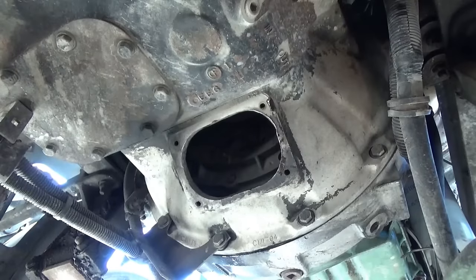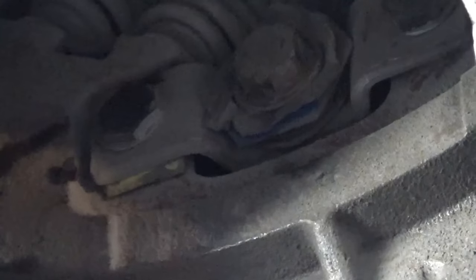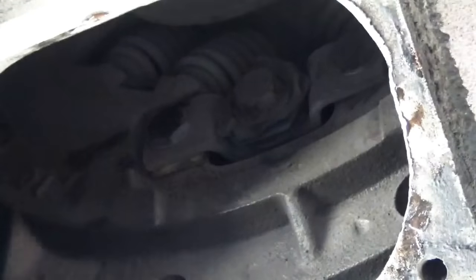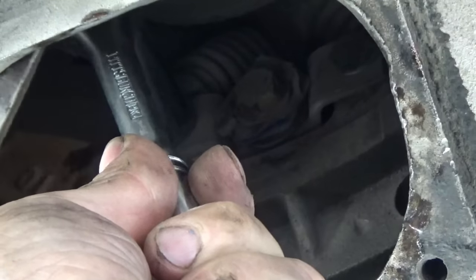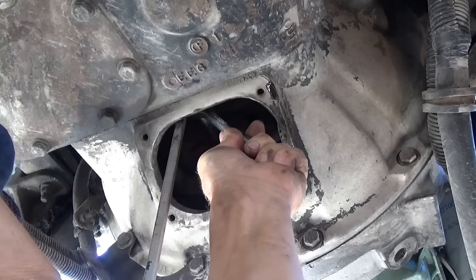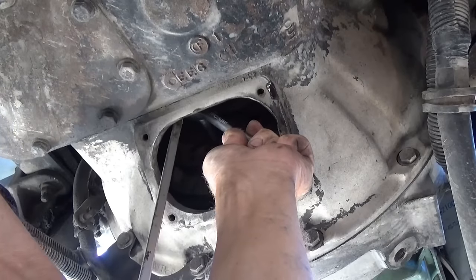Let's go back underneath. You've got to push that bolt in. I tried to do that a few minutes ago before I went back and got more tools — using a 5/8 socket — and I could not push it in just with my hand. What I had to do was come out here with a big screwdriver and pry against that. I had to pry between the ratchet and the hole here using a long socket and force that spring to go in.